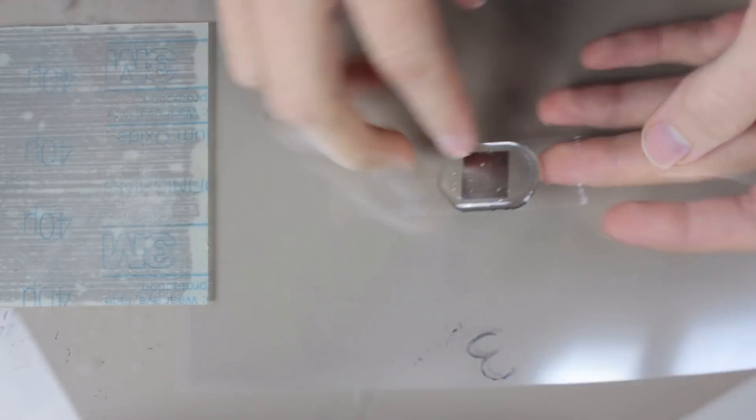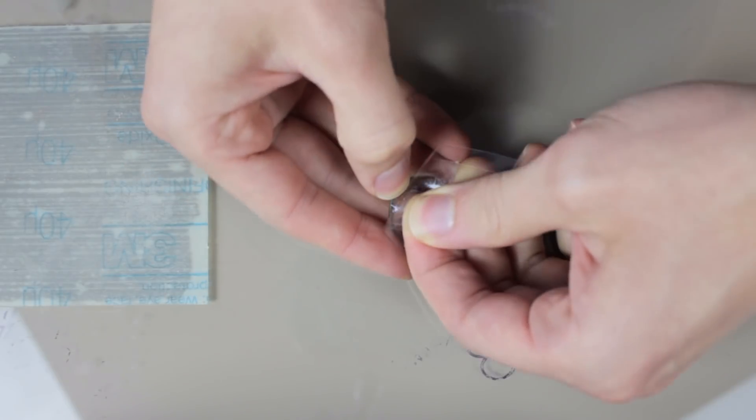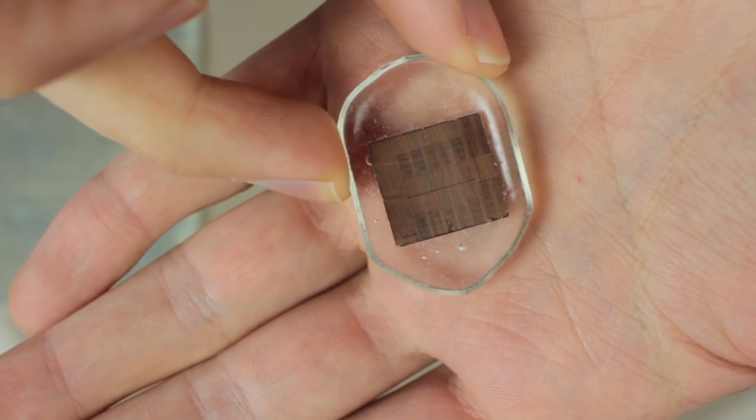Once I had the die removed, I started grinding it down again, because you have to remove the top golden connection layers before you can begin the proper polishing and grinding to expose the transistors and cores. After that I decided to use some resin to cover and protect the die — that is what was shown in the tutorial by Fritz, the German guy who came up with this whole idea on a German forum. I'll put the link to his YouTube channel in the description. After about 24 hours the resin was hard enough to peel off the foil from the bottom. I had the die attached with double-sided adhesive tape to some foil and put epoxy on top; after the epoxy hardened I removed the foil and started grinding the die again.